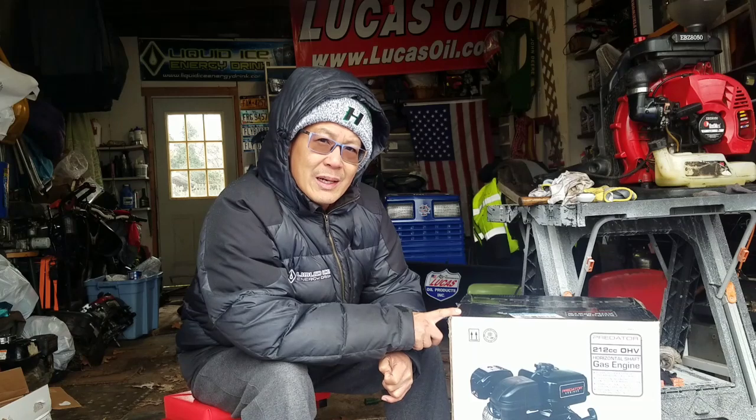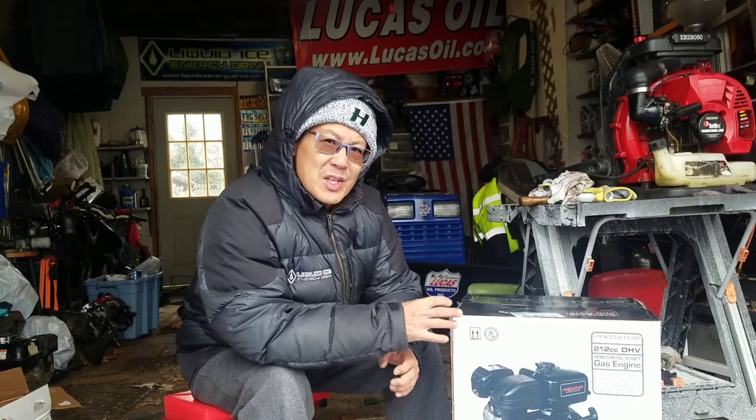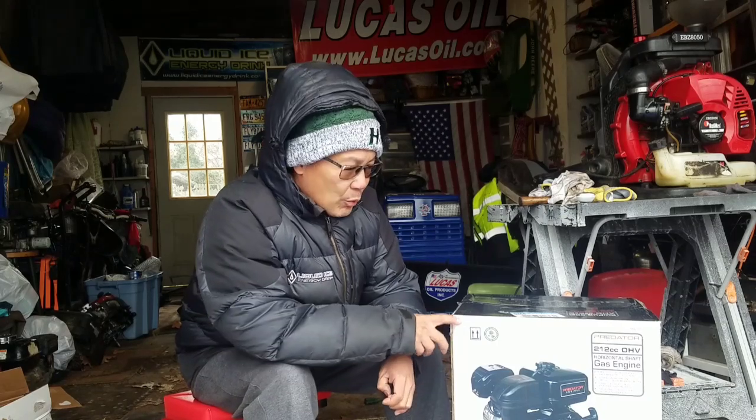Anyway, so I needed this for a tamper plate compactor, Mikasa Multiquip. The Honda GX160 horizontal shaft engine smokes a lot. Oil seeps through the rings and piston, so that's what causes all the smoke. So the cylinder wall is out of spec, and it has a wobbly piston. So we have to get rid of that engine, and we're going to put this engine on.